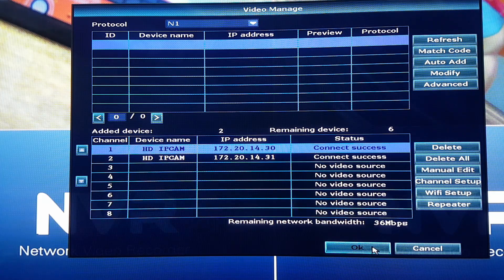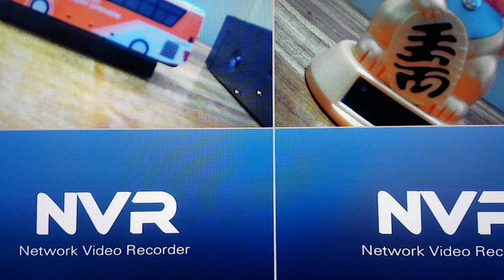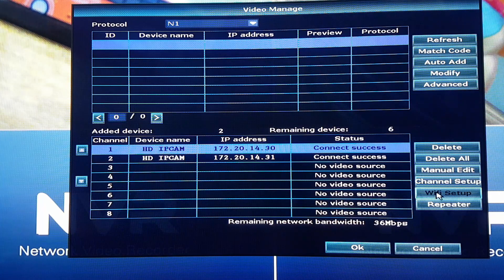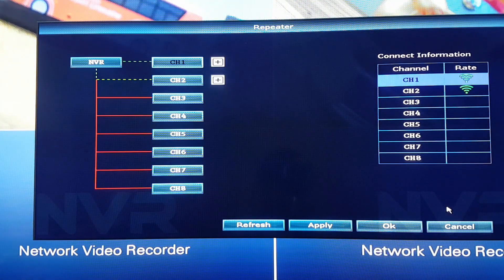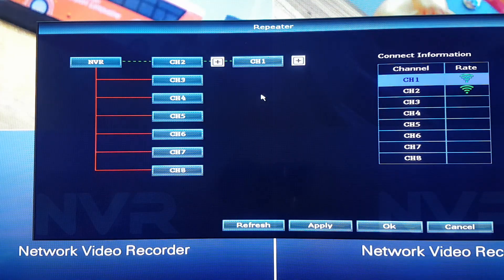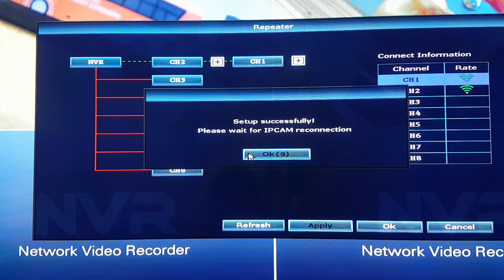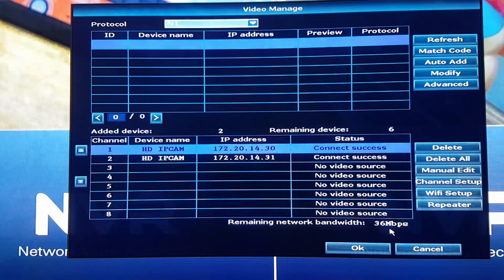As you can see, we have two IP cameras installed and we will use one of the cameras as a repeater, for which the other IP camera can connect to. A maximum of three cameras can be connected in series through the IP camera repeater function. Once you select the client IP camera, the table corrects itself. Clicking on apply will send the command to the IP cameras to connect themselves accordingly. Both IP cameras are now successfully connected in series.